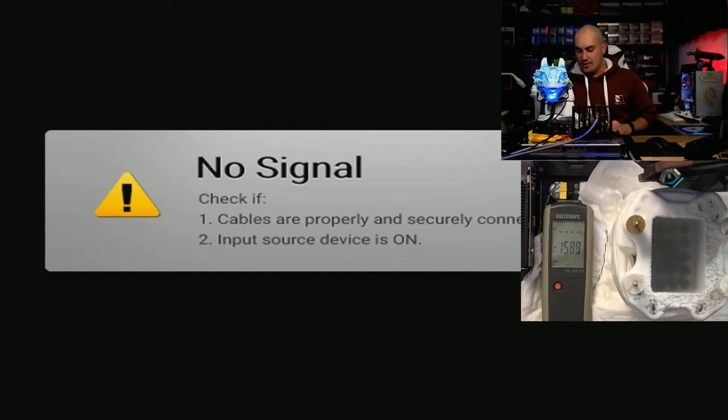Now, the LN2 BIOS just tweaks a bit the voltage. I think the LN2 BIOS extends the maximum CPU voltage and the maximum memory voltage, and it starts at default with 1.35 with the SOC. But I don't think it does much more than that. Actually, sometimes without the LN2 mod, I don't have the cold boot bug, but I cannot raise the CPU voltage anymore, more than 1.7, 1.6, something like this. So sometimes it's the BIOS that is really bad. I think you can do that. I once did it by mistake, but if you run things that are very heavy on the memory controller, you will fry it. So it's not good.